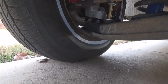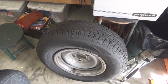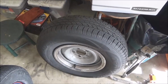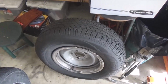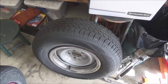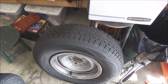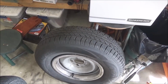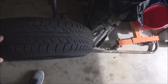Both new socks and shoes. So like I said earlier, think your decisions through before you just jump in and do something. I had to get these tires to get the truck inspected. I knew I was going to upgrade, but didn't plan on doing that anytime soon. Then I went ahead and did the Belltech drop. Did not have an understanding about 15-inch factory rallies hitting the lower control arm. And so, like I said, read the instructions. Anyway, this was a hasty move on my part.